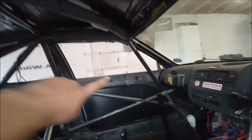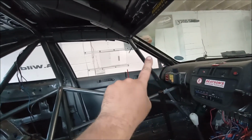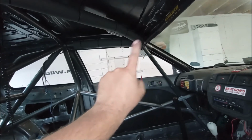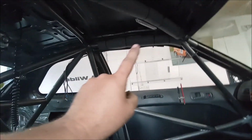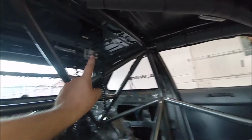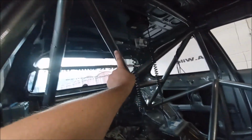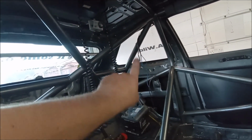Next, there was a bundle of wires curled up here on the dashboard, and they run up this A pillar, and then they spur off for this LED light here, and then the earth for it is there. So I've done that, connected that up, and then there is a map light just on a clip under there, earthed locally up there as well. So then the cables run around here, and then they run around here. There is a GoPro switch on the dashboard, that red button just there, so there's a cable for that. There's a cable for the intercom with an earth as well, and then there's a light back there too for the boot. And then that should be the end of the wiring, this little loom here.